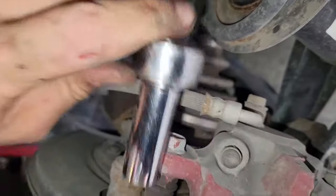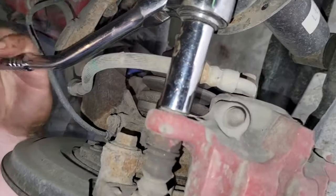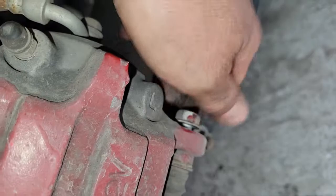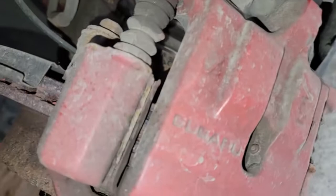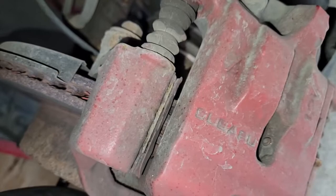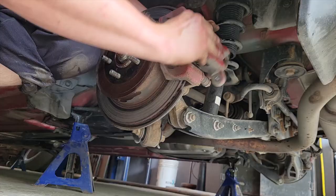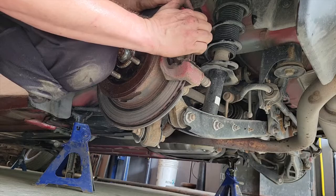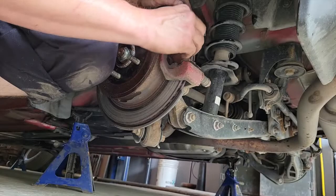This is behind the caliper. We're going to take the pads out first. Crack those top bolts loose, crack the bottom ones loose. Now that they're loose, we actually take that out by hand. These calipers were painted by hand also — not powder coated, painted. We've got our two 14mm bolts out, we can pop this off. Wiggle it. Hide your caliper up somewhere safe — we're not going to mess it up. Here we can pull out our pads. These are crusty — there's not really anything left of them.